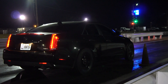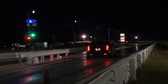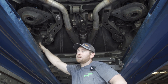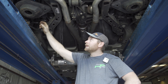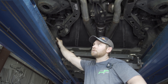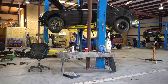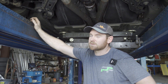With slicks on the car, you want all the weight transfer to go to the rear. You don't just have your coilover compressing — you got your lower control arm and your upper control arm, your whole suspension is moving along with the coilover. There are a lot of fast people out there with independent rear suspensions, but going with higher horsepower, your CV axles are a big downfall because of strength. If you're putting a lot of load behind launching a car at 4,000, 5,000, or 6,000 RPM — depending on if you got a turbo or blower car — that's a lot of stress on those joints. It's harder to go faster in these cars than in a solid axle car.